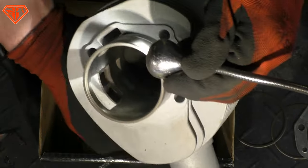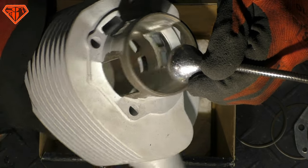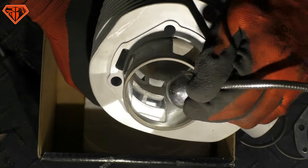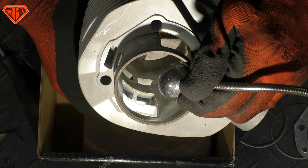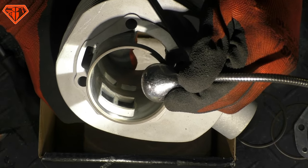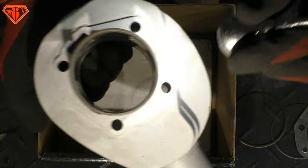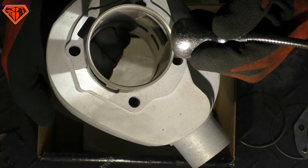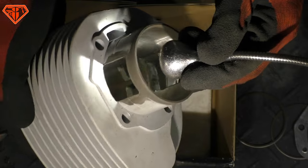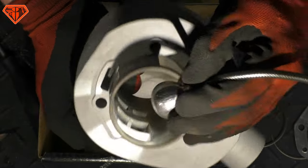And it will make a lot of original owners who are scared of adjusting their engine cases decide to go for the cylinder, because it is still closed and you do not need to change something at the engine case, so it means it's plug and play. I have to make another video guide for that. It doesn't matter if you have open transfer ports at the cylinder and at the engine case, it still works. So every cylinder you have, the Polini, the Malossi Sport, with the open wide transfer ports, you just put it on the engine case and don't worry, it doesn't look so cool, especially if you like to flow engines like I do.